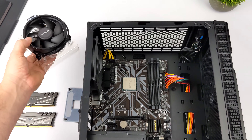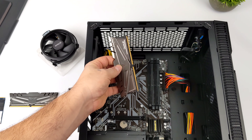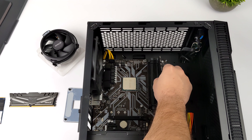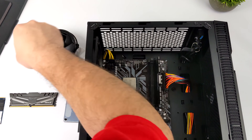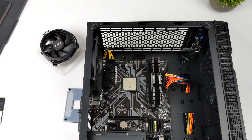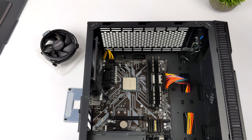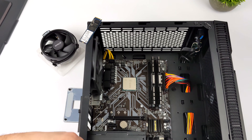These coolers come with thermal paste already applied. When it comes to Ryzen APUs you definitely want to get the fastest RAM possible — it's going to help out with integrated graphics performance. I chose 3600MHz RAM, 16GB, but we're actually going to overclock it to 4000MHz from the BIOS. The B550 version of this board will support up to 4400MHz but that stuff's really expensive. You can pick up this exact 16GB kit for $65 right now. For storage I opted for a cheaper Kingston M.2 SSD — 512GB. You could go with a 256GB or even a 2.5-inch drive if you want to get out cheaper.